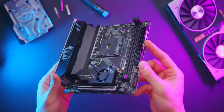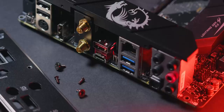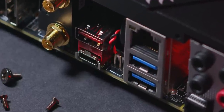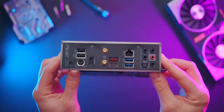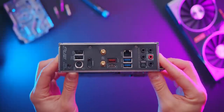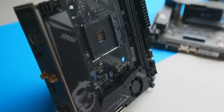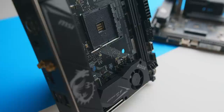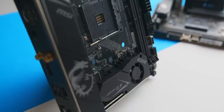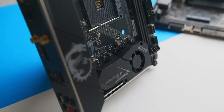One thing I encountered on the MSI board that I seriously despise is that the clear CMOS header is hidden behind the pre-installed I/O shield. If you run into any problems with CPU or memory overclocking and your system doesn't post, you can't reset the BIOS without removing the board from your system and shorting those two pins. Most users hopefully won't need to worry about this, but it doesn't excuse this absolutely terrible design choice. On the plus side there is an actively cooled M.2 slot on the front, so if you're running a high speed NVMe drive this might help you avoid throttling.